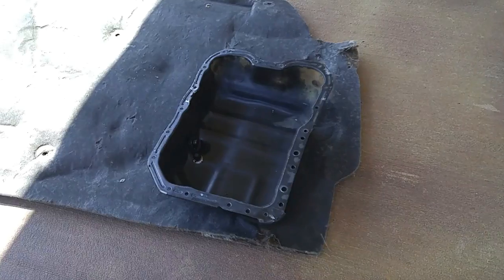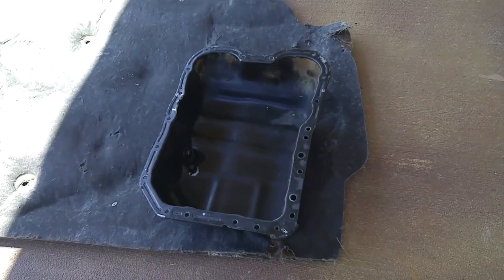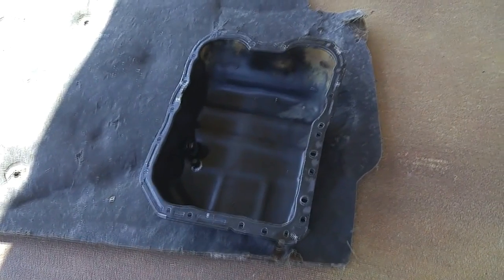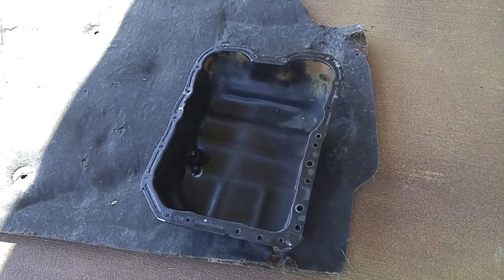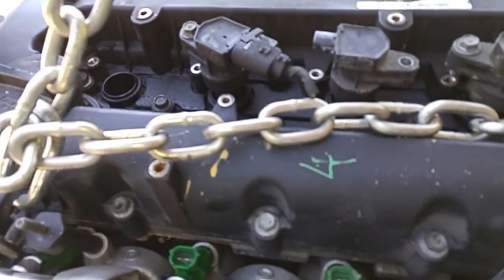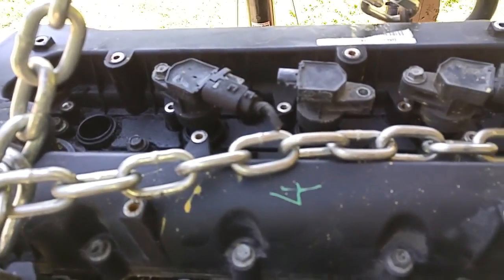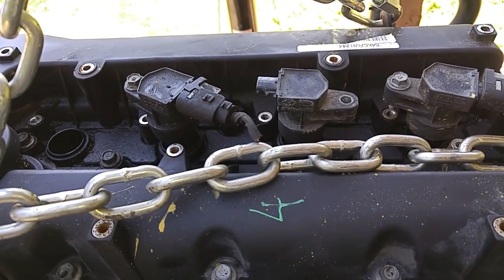To reduce the possibility that I'm dealing with a bad engine, I take the oil pan off and look for metallic sludge. We took the pan off on this engine and there was no metallic sludge in the pan. Remove the spark plug and inspect the color. Black charred plugs would indicate excessive oil burn, an over-rich air-fuel mixture, a bad coil pack, or a bad fuel injector.